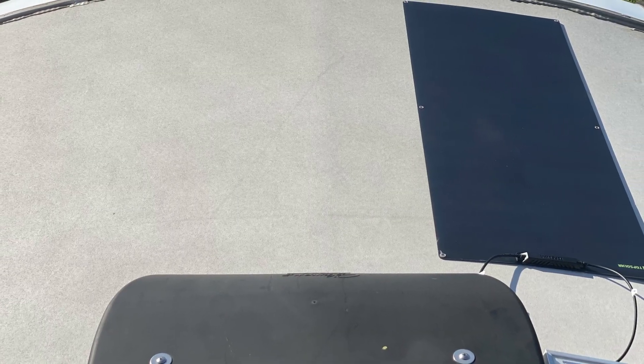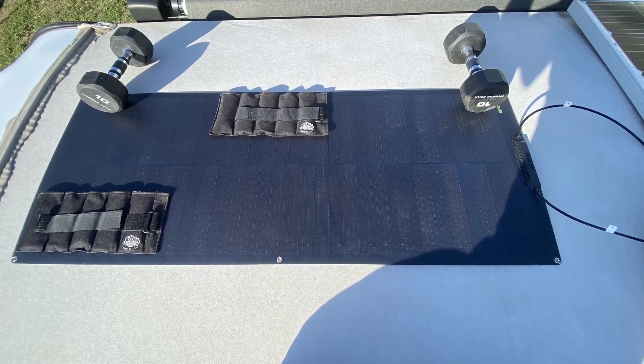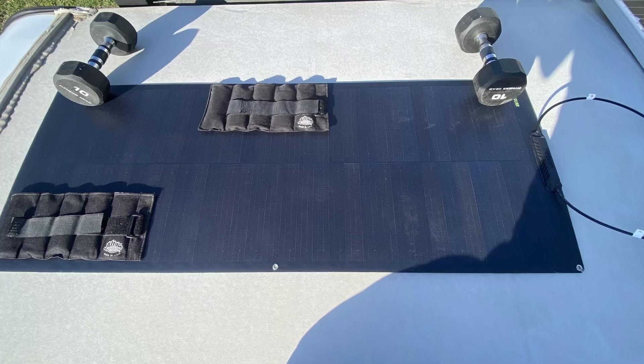I've had zero issues after traveling almost 5,000 miles with this setup with the original panel I put down two years ago. So after having that many miles on the road, I am confident this is going to work for this new panel install as well. Really all I had to do was put the panel up on the roof and weight it down. There is some curvature to the roof of the RV, so I did need to add some weights to make the solar panel conform to the roof itself.